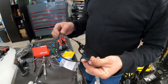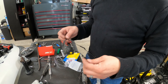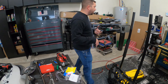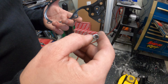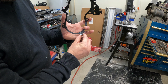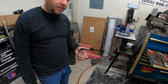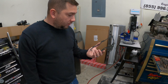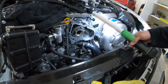Now we gotta drive to a different city and pick this part up — it's about 30-40 miles away. Because this gasket was a little moved, the bolt went in crooked and just destroyed the first couple of threads. It looks a lot worse because we had to pull it out, but because the hole was just slightly offset, the bolt went in a little crooked and messed everything up. So we made a mistake, we learned from the mistake, we're gonna pay for the mistake — and this $10 mistake, we needed a new gasket anyway.